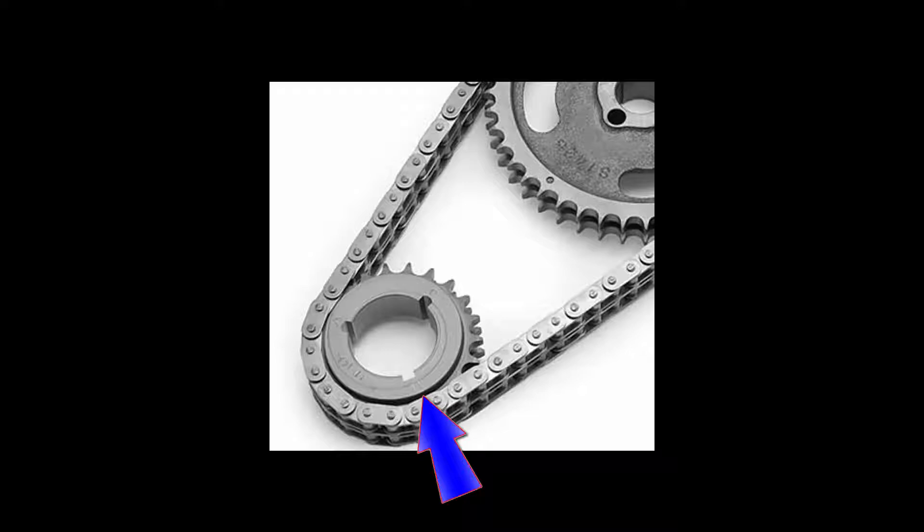The camshafts didn't consider this. When custom camshafts are ground, they assume you have a straight up cam timing chain and there's only one slot so you can't change it. So I'm going to have to back out this eight degree advance from all my measurements to get back to a straight up timing mark equivalent, which is required for my numbers to match the cam datasheet.